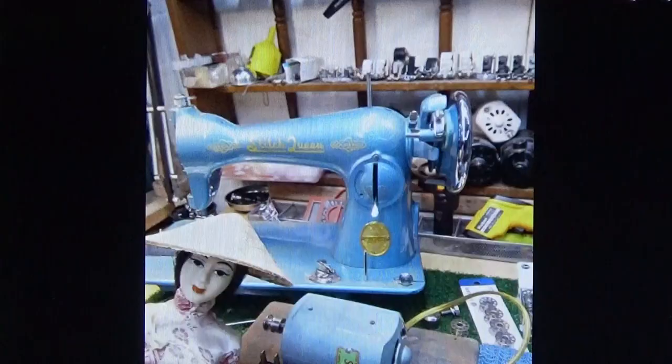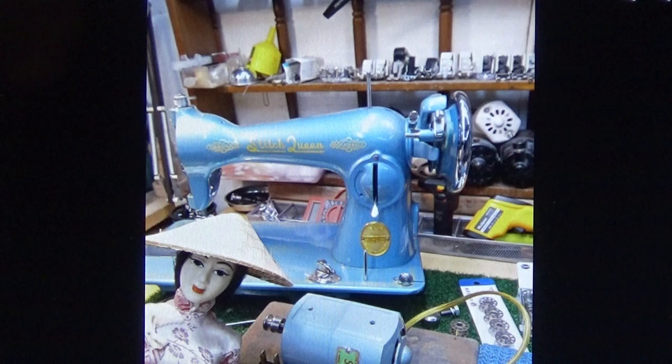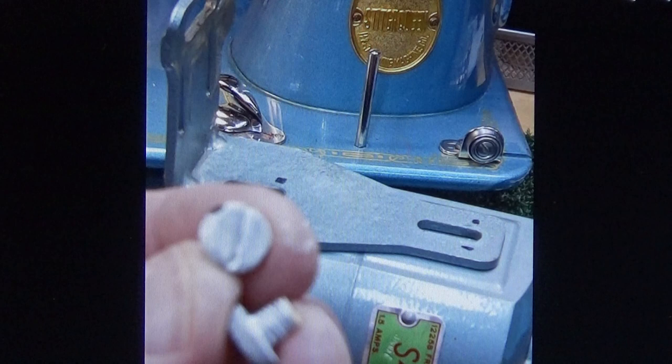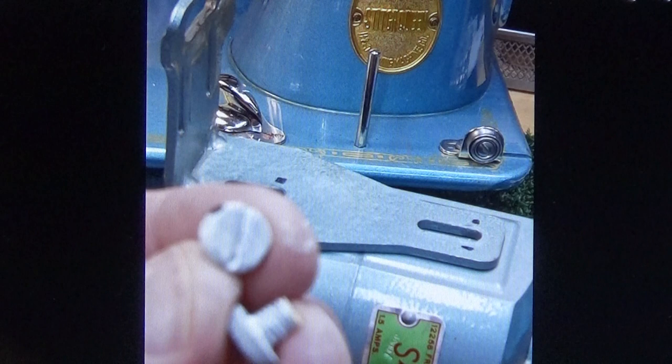Here we've got a very happy motor, a motor that is ready to be reattached to the machine and get the job done. And again, when you're taking brackets off of motors and that, just make sure you mark those points in the beginning so that you can get it calibrated and set up correctly, so the alignment of that belt running over the balance wheel and coming off of that output pulley on the motor are perfectly aligned. Otherwise, you're going to be prematurely wearing the belt and you're going to be creating drag and causing that motor to run a lot harder than it needs to run.